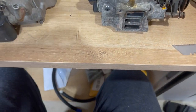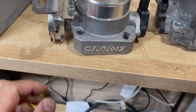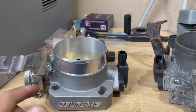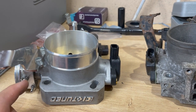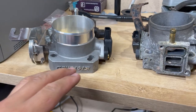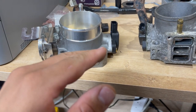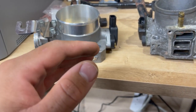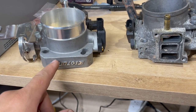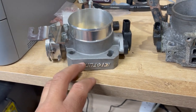We just have to cap this off and cap this off and everything's good. If you compare both of them you can probably see the difference. TPS is on now. One other thing - if you guys are having a sticking problem with the K-tune throttle body, like rev hang where you have to mess around with the gas pedal to get it to drop down to normal idle and it's getting stuck - I've had that happen with my RSX with the 72mm billet one from K-tune. It's notorious for that.